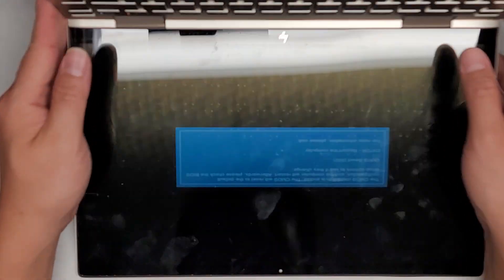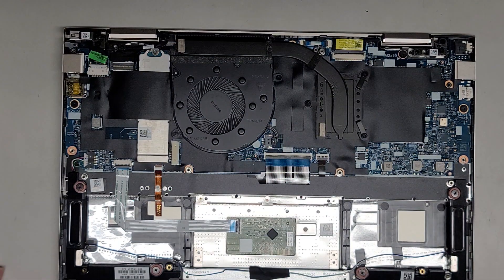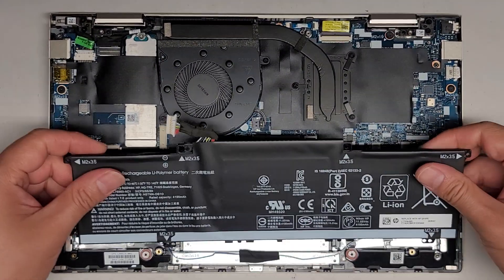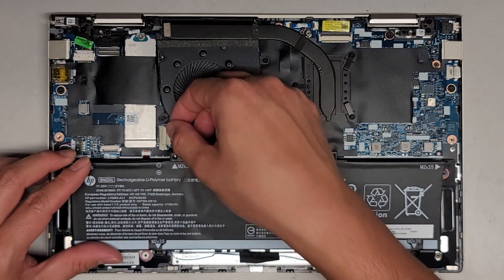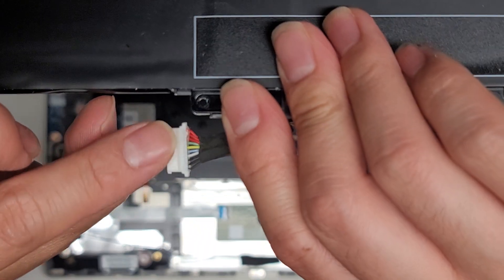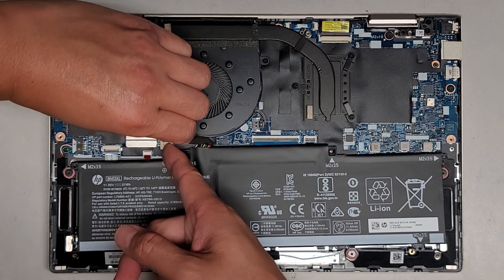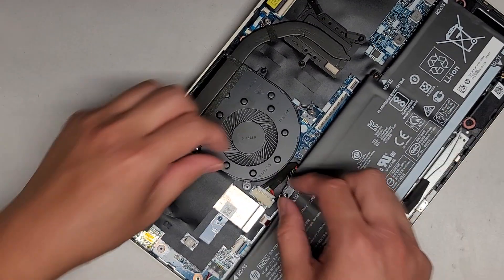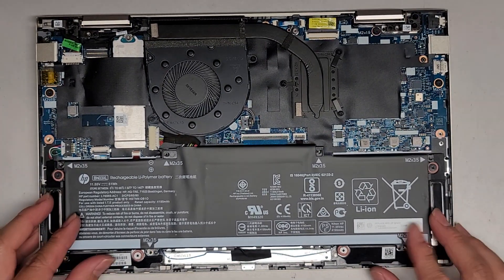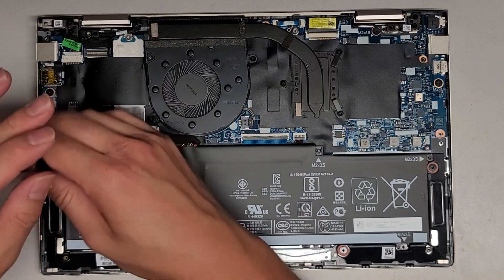The light for the power button is on, and there you go. So I think we're good. I'm going to turn this off and then I'm going to put the battery back in, and we'll try the normal charger. Luckily, this thing protected itself — it detected a short and then it just cut power to the system. If you replace the battery, make sure you put the connector the right side up with these metal exposed pins faced up. You don't want to put that flat side faced up or you can fry your computer. So we're going to pinch the connector back into place. Get the battery back lined up and we'll get the six screws back in.